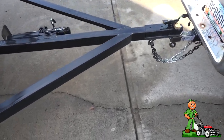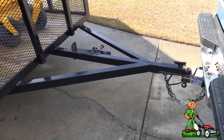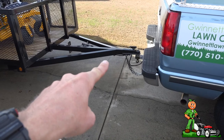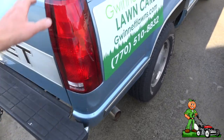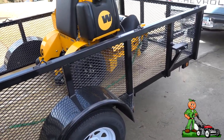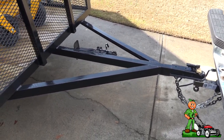I do need a drop hitch — I think I need about a three-inch drop hitch. But I can't find anybody that makes one; I see them at a minimum of six inches, which would be way too much. The trailer is a little nose-up because this is a four-wheel-drive truck. I took the trailer off last night, got it level, put a level on it, and measured — I think a three-inch drop would be sufficient. The suspension on my truck is really stiff, so it didn't hardly squat when I loaded this mower on, even though I think it weighs about 900 pounds. If you guys know where I can get a three-inch drop hitch, let me know.